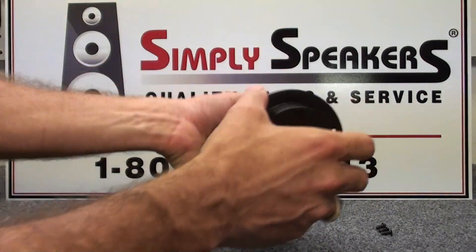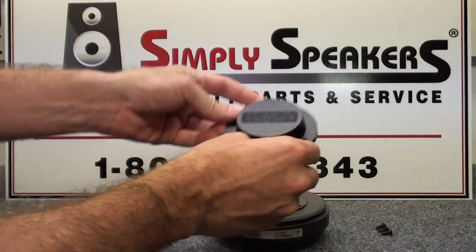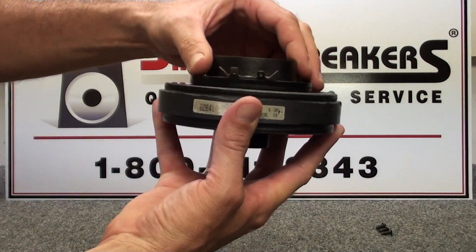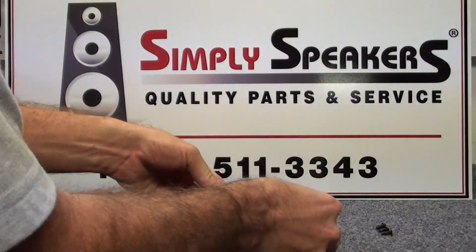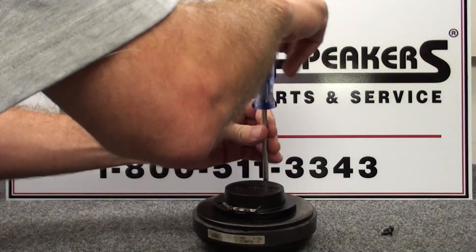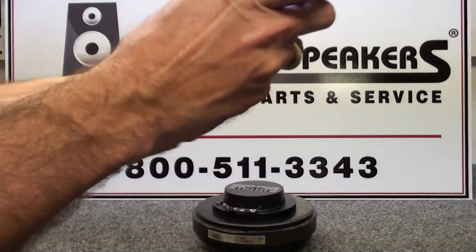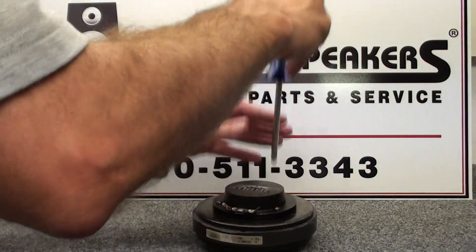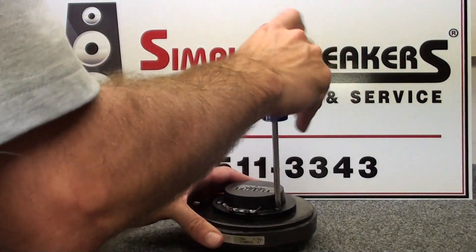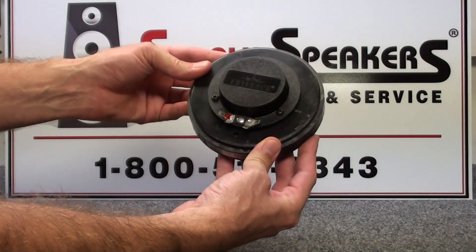The key is to line up the tabs with the hole at the bottom of the diaphragm or the magnet top plate. There's a molded groove in the top plate of the magnet that centers the diaphragm automatically for you, so that part is very straightforward. Line up your screw holes and replace the three screws — snug them slightly at first, one, two, and three — then go back and give each about a half turn. Don't over-tighten the diaphragm screws and crack the plate, as it's made of plastic. Everything went together very nicely.